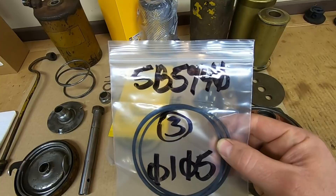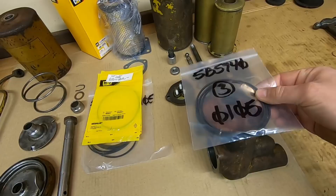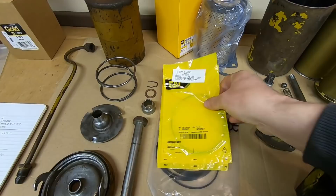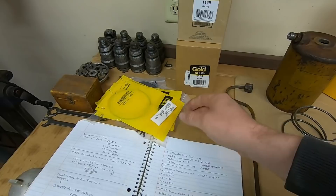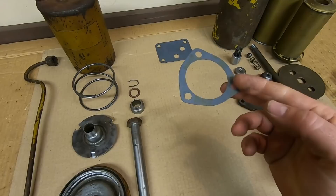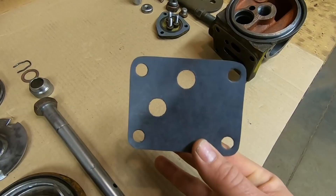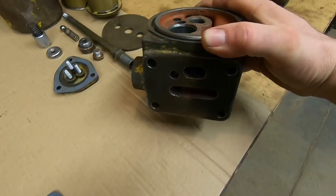The seal for the filter can to the old base is 5B5940 — that's pretty much a standard size for any of these D3400s regardless of filter setup. The upper seals, which in this case is the adapter ring, are 5B5937. I keep quite a lot of those on hand because all the D3400 filters are good about using those two seal sizes. New copper sealing rings were also applicable, and I made my own gaskets for this application — pretty simple, only two required: one for the small side cover and one that seals the oil filter base to the oil manifold.